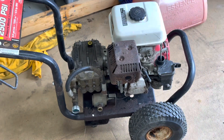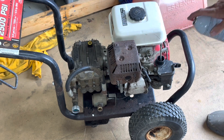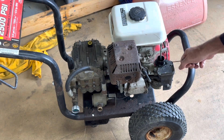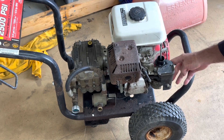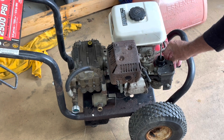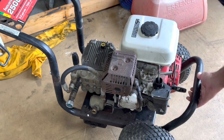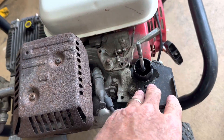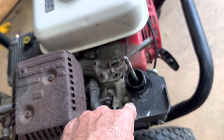It's got gas in it but we're assuming it's bad. I did go ahead and turn it on just in case. I can't run it without water, but I already got the air breather off. I'm using carb and choke cleaner — same thing as starting fluid. The choke is on, open the choke and let it in there. [Engine fires] All right, that's what we want!